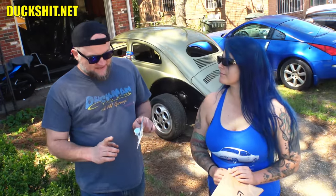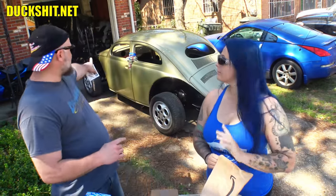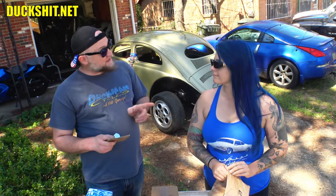They are aftermarket tins, and if they don't fit like OEM tins and they leak air, then your engine will overheat. Yes. And that's probably one of the reasons why people say such things, because aftermarket stuff just isn't as good as the original. Now, I will be going through everything, and I'll be making sure that it fits properly and that it is sealed up, because, you know, I do work on metal. And I think I kind of know what I'm doing. So I will make them fit appropriately.